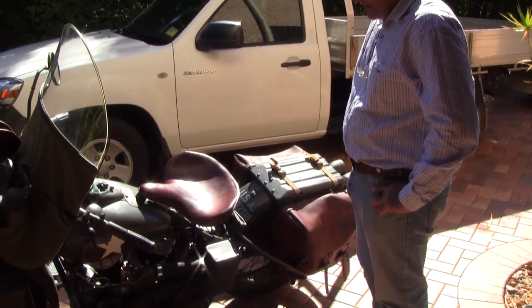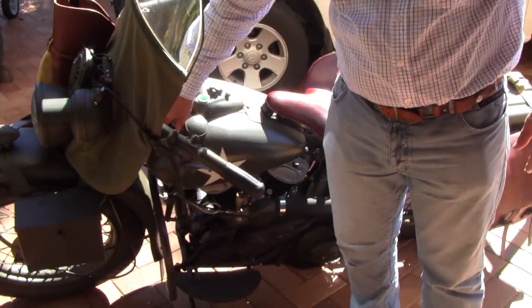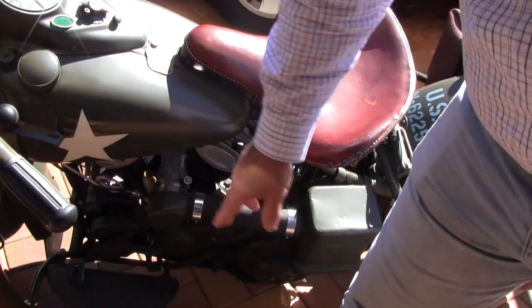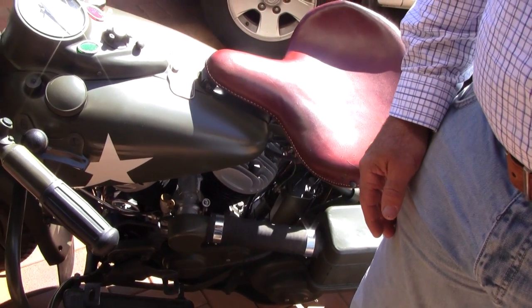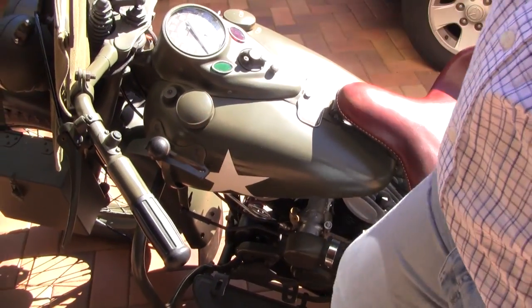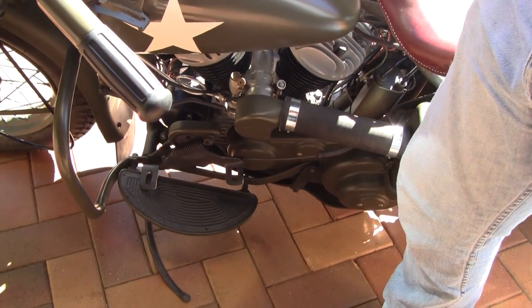I've walked up to the machine, I'm going to start it. How do we go through starting the bike? Righto. Fuel tap, or fuel knob, is under that, and that's sprung, so it opens up and lets fuel run into the carburetor bowl. So you've got to wait a little bit, you wouldn't want to get a quick getaway. So it's a gravity feed. Yeah. Got to make sure the gear stick's in neutral with the clutch at the front down, otherwise it won't engage the kickstart.